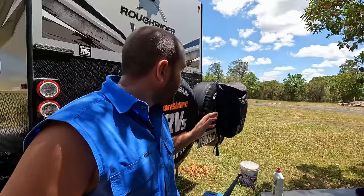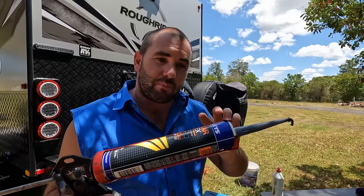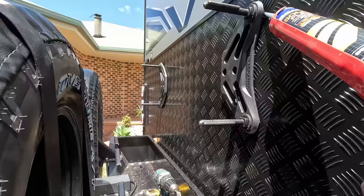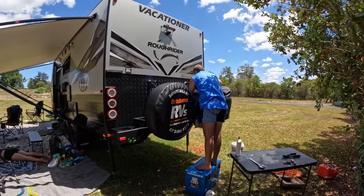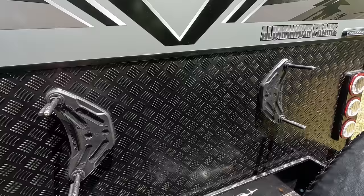It's pretty simple. Just making sure they fit. And the last little thing — I'm just anal — but I'm going to run a bead of this. This is Sikaflex, and it is very good out in the weather and the sun, and a great glue and sealant. So I'm going to use this and go around all the base plates and then over my rivets and everything, just so it will not leak. Let that go, put the Maxtrax on, and we should be finished.